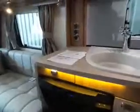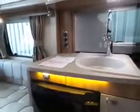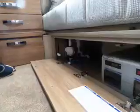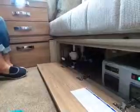First thing to do when you get into the van is get the water system up and running. In this corner is your boiler and heater. You can see that yellow lever there — that is the drain for the water system. In the position it's in now, water can run around the system. If you lift it up so it's pointing upwards, it'll drain down onto the ground outside. Make sure it's in the correct position before trying to fill with water, otherwise you'll just end up with a big puddle under the van.